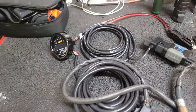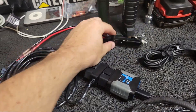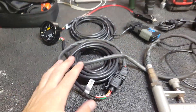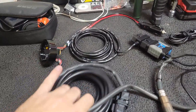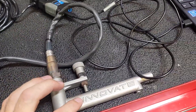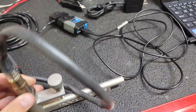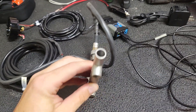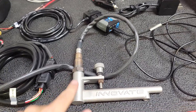The 12-volt power here is going to power the gauge and also the heater circuit for the wideband sensor — that's this coil wire here, which goes to the wideband sensor. Then I have this Innovate tailpipe connector. This would go into the tailpipe, and there's a port on each end to allow exhaust gases to flow through and hit the sensor.